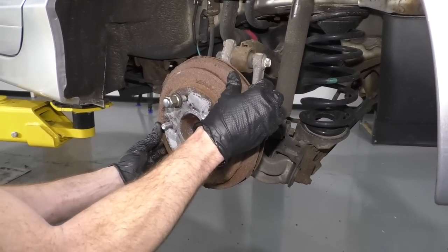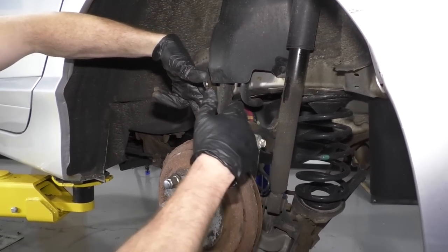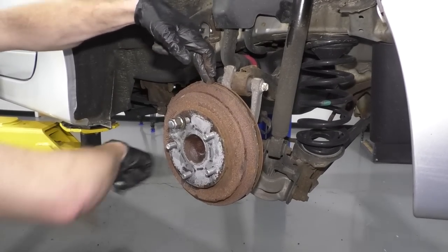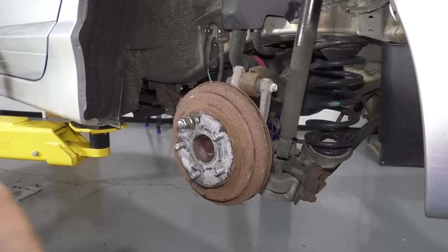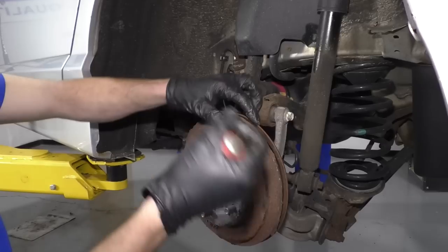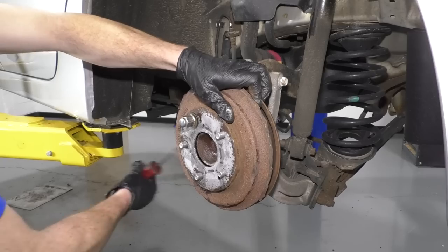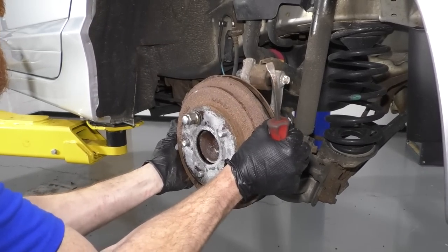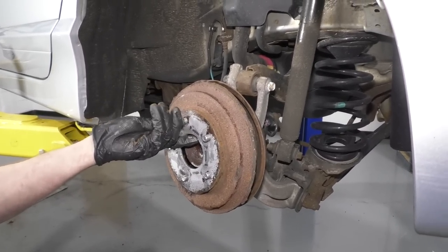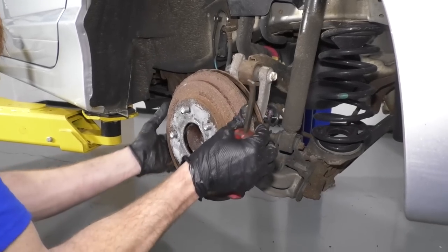You can try to work it with your hands. If it's a little stuck, grab a pry bar, come in between the backing plate and the drum, and give it a little pry. Once it breaks free here, go over there until it finally comes off. Gently pry — we don't want to bend the backing plate, as that could cause issues putting it back on. That feels like it broke free. Now remove that lug nut and continue removing the drum.